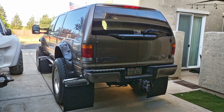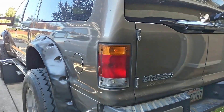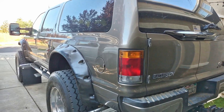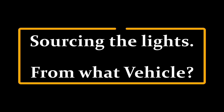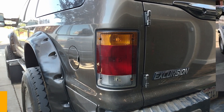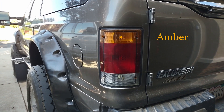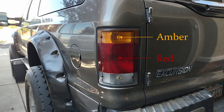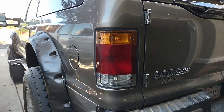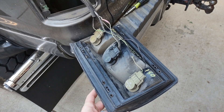This is how to change the Excursion from an all-red brake, tail and turn to the 1994 Ford Econoline van style, where they have the tri-color — the amber or yellow for the turn and then the red. One of the first things you'll need is to buy that 1994 Ford Econoline tail light with the tri-color amber for the turn and red for the tail and brake. Grab yourself a set of those and just a few other wiring items.